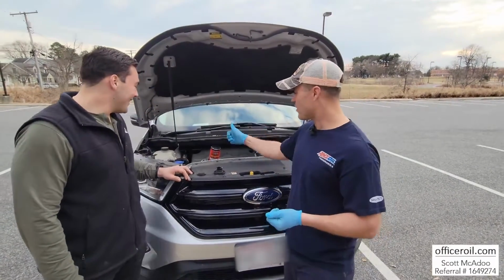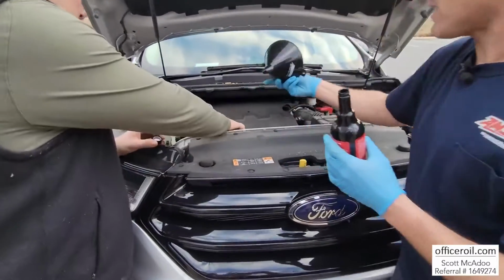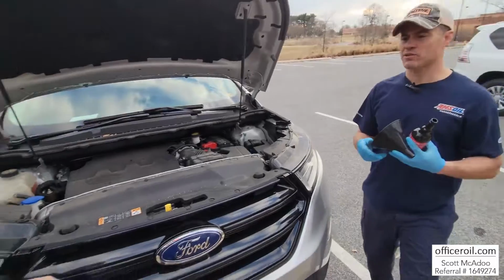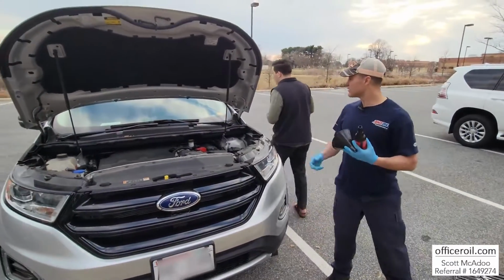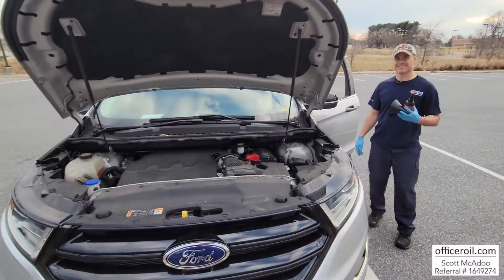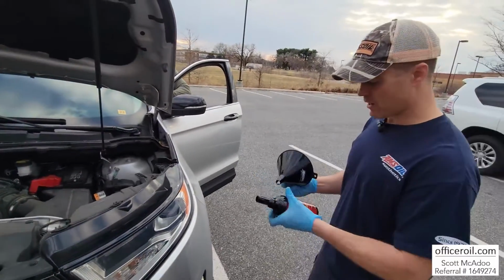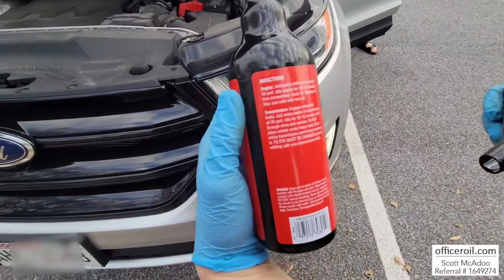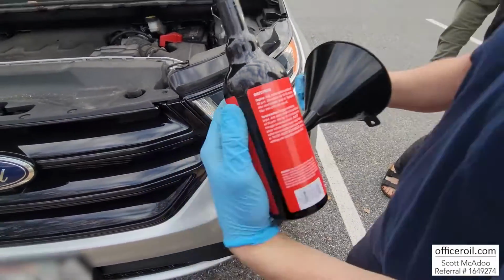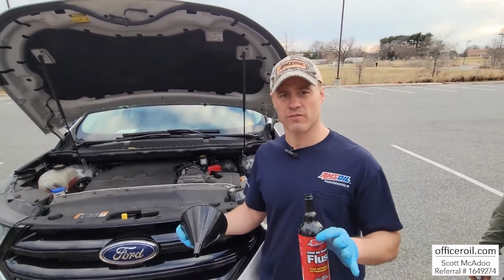Thank you. All right, let's go ahead and put our cap back on. Let that drip there. Perfect. Then let's start it up and start our timer again. Fire her up. Start your stopwatch, and we're gonna go another 15 minutes. All your directions are right on the back, but no longer than 15 minutes. Very important, don't drive it with this. Don't put a heavy load on it, just idle, no more than 15 minutes.